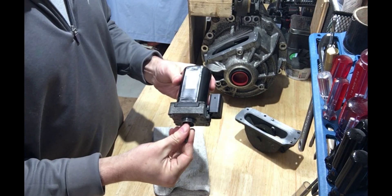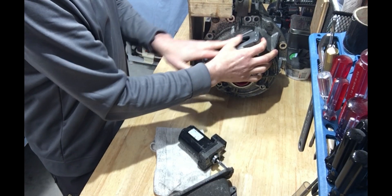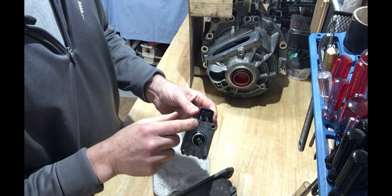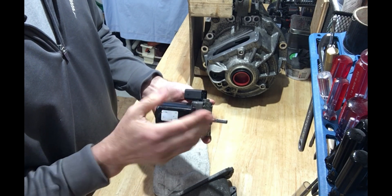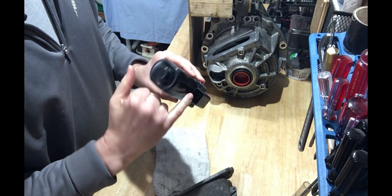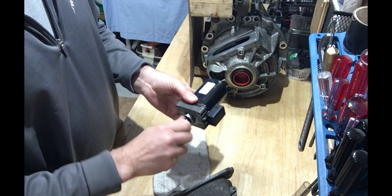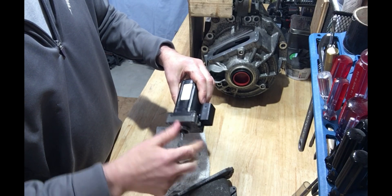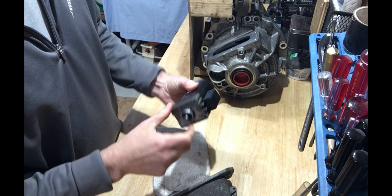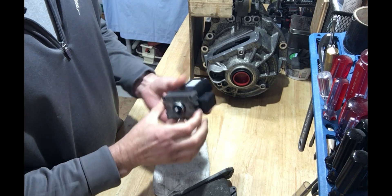I want to take a moment to look at this 12-volt motor that drives the gears and engages the clutch discs. This particular motor is nothing special. I've seen the Land Rover variant as well — they have a locking differential with a circular connector rather than the square one found here. The square connector has two main pins and eight minor pins. The two main pins go to the armature. It has some cogging — there are magnets in here, probably like a wiper motor, a permanent magnet DC machine. The other eight pins are probably for position sensing and direction sensing.